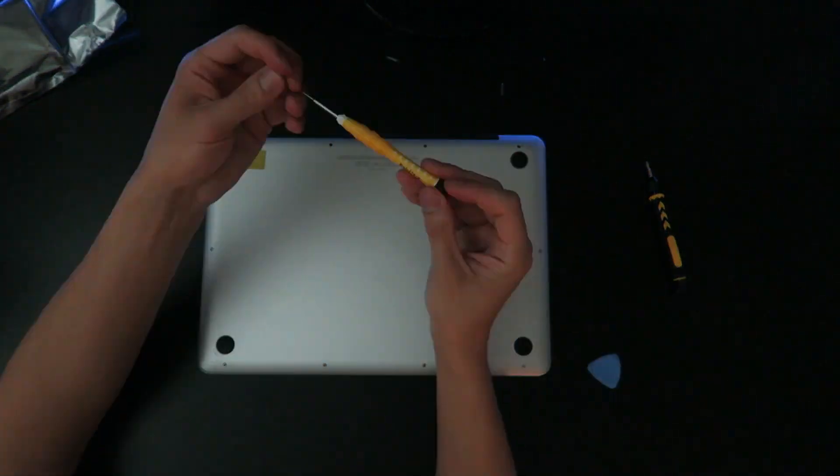With all upgrades in, we're good to go and can start installing macOS. Boot up to macOS Recovery to reformat your SSD and install macOS onto it. Then wipe your mechanical hard drive and you're ready to boot your laptop. Personally, I kept the SSD as a boot drive and rerouted my home folder and user folder to the mechanical hard drive — that way storage stays on the hard drive and all applications run on the SSD for faster processing. Comment below if you need a video for that. Thanks so much for watching!